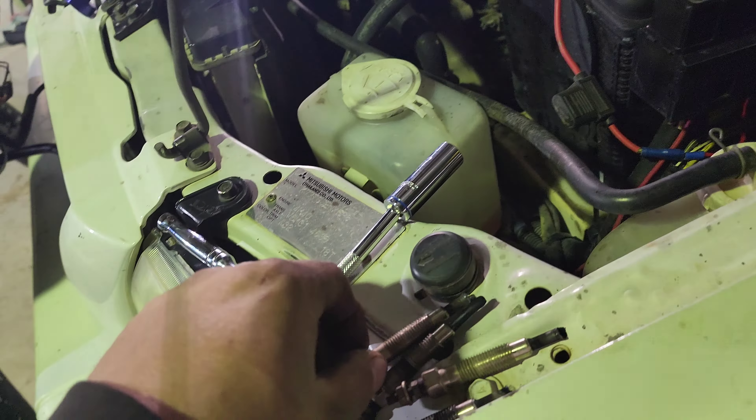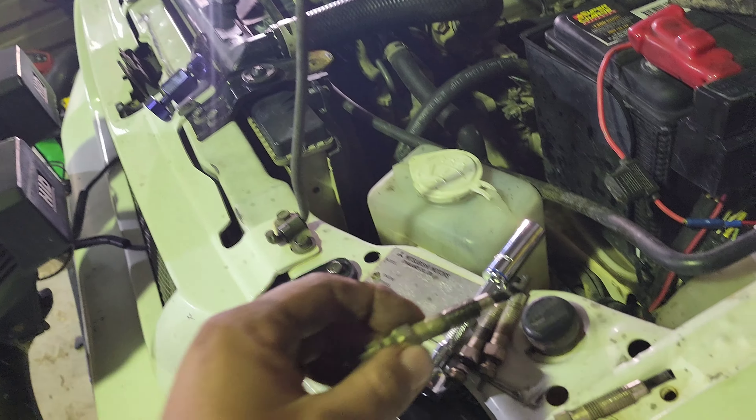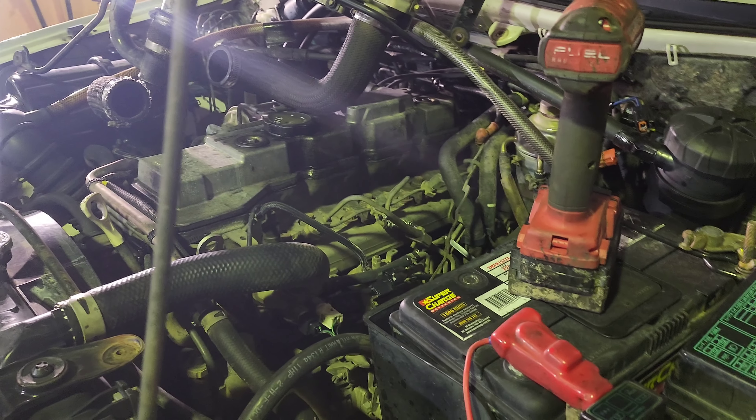And so I've just pulled the old ones out, just for reference, so I can show you guys what's going on. Now I put these in 20,000 Ks ago. But in the meantime, my temperature sensor failed. What the temperature sensor does is tells the glow plugs to turn off after it starts. In summer I didn't notice that the glow plugs weren't working — it was a little bit smoky sometimes on a cold start on a cooler morning. This thing still compression starts with no glow at all, obviously, because they don't work.